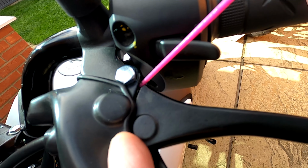Remove the rear seat and cover the frame and shock tops with ACF50. Use the silicone spray as shown. Spray grease the rear locking mechanism.